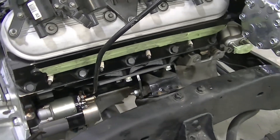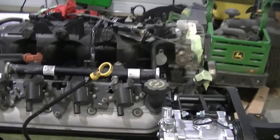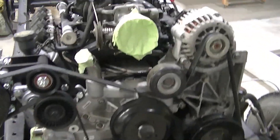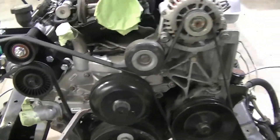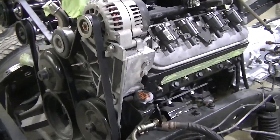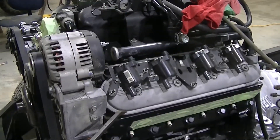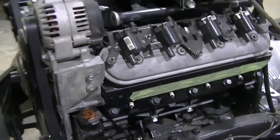I got a new starter on it because the solenoid was bad. I think we're using the same coil packs. We did go and replace the water pump — got a new water pump for it. Kept the alternator since it was fairly new, so didn't do anything with that. Definitely put valve cover gaskets on both sides, and basically just cleaned it up. New motor mounts.